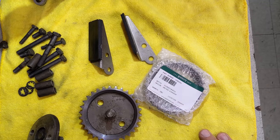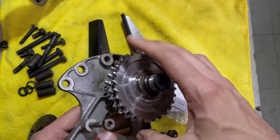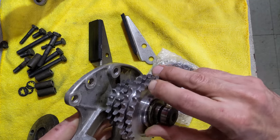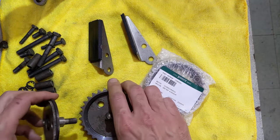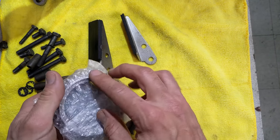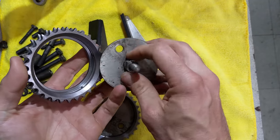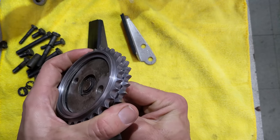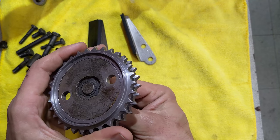In my last video I was really geared up to put all the new timing gear into the XK motor. Got all new sprockets here — you can see one right here on the carrier. The sprockets and teeth that were on there had a bit of a line cut into the side, which meant they needed to be replaced. Again slightly frustrating — one of my new camshaft sprockets didn't fit the assembly. Let's try this again. There we go — it's tight but it works. Okay, we're off to the races.